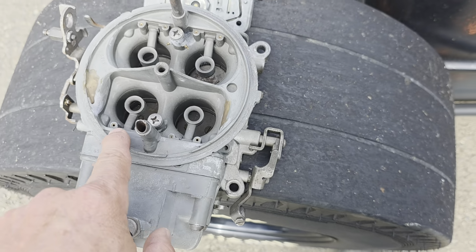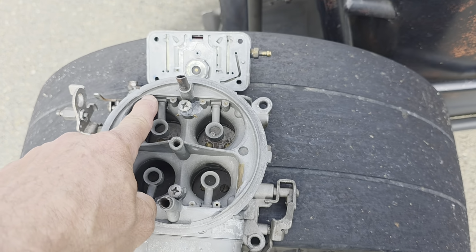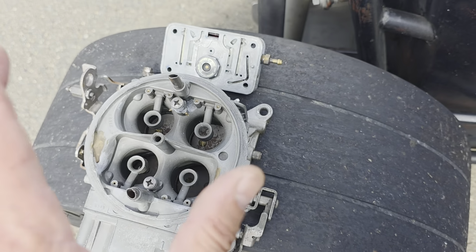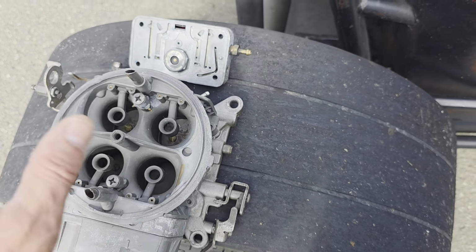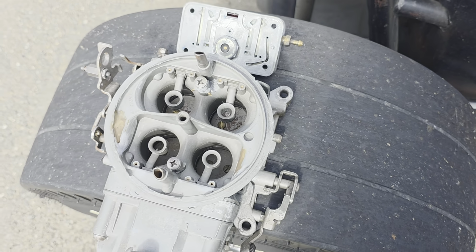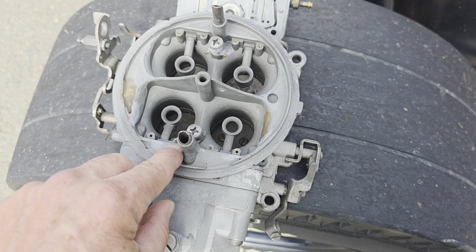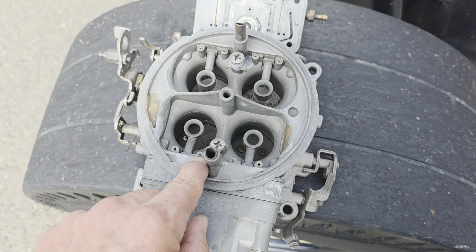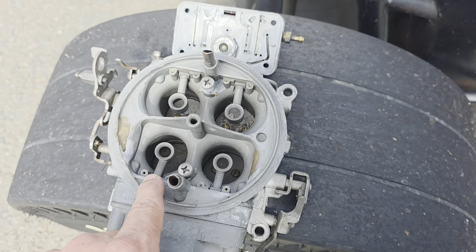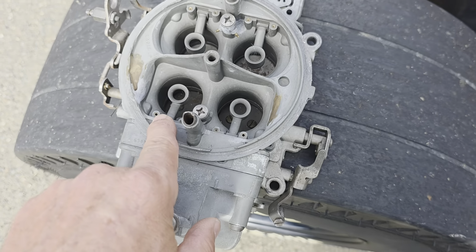So what he was having me do was drill these outer ones out to lean out my idle and give more air. As you know how a carburetor works, it's pulling air from the top. It's not going to be pulling any fuel from the top. There's no fuel up here, it's just drawing air. So I drilled them out. He uses a brass set screw, I think it's a 10x32, on the top here, and he had the idle airs drilled at 70 thousandths.